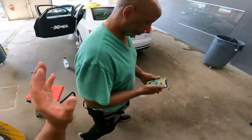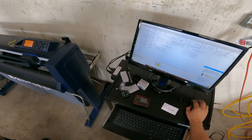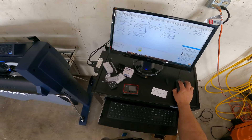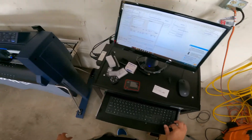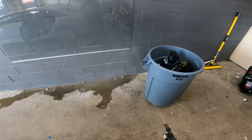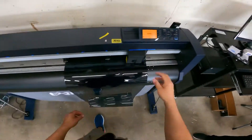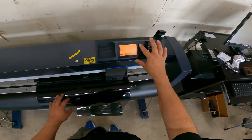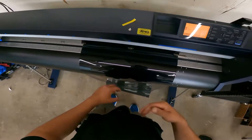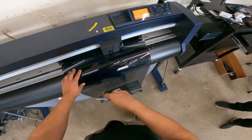I'm working on the driver back door. I'm going to cut this one right here — driver control, Shift+P. There we go, enter, it's gonna cut. I'm gonna wet my peel board so when I get there it's all wet, then I'm gonna do a cross cut. It's gonna cut the film off for me, and then I'm gonna go directly to the peel board and do my trimmings. I need tight cuts on the ends and the bottom edge — the top not so much.